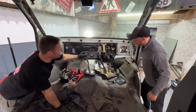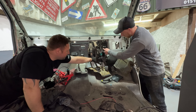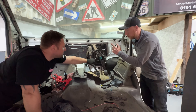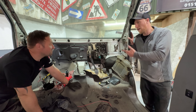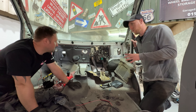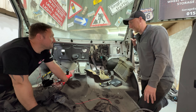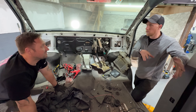Inside we need to lose the clutch pedal. The throttle pedal is obviously usable because it's linked to a helipot here which we can use with the AM system - fly-by-wire, six outputs, so we can use that as a dual hall sensor. We think we need to put the iBooster in because the original van one won't have enough power when you've got four-pot brakes everywhere. We will have regen though - putting a decent iBooster in has a lot more power just in case the regen doesn't work at some point. With a big motor in the front we can have really good regen, so chances are we'll hardly need the brake pedal. And obviously a hydro handbrake, especially when we're towing this van whilst racing a van.